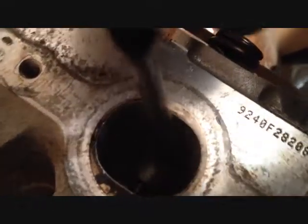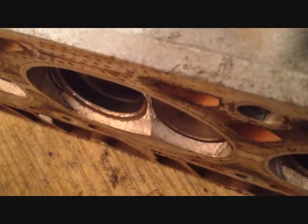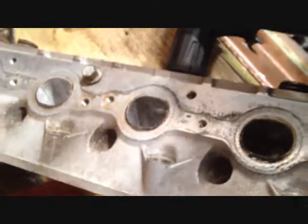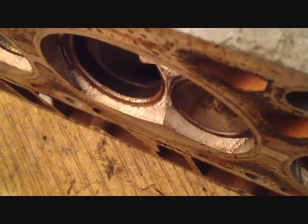Still fluid, and no leaks. So, going on to my drill valve grinding this. You can see what I was doing there. I was going till I started to bog the drill down, then letting up and then hitting it again. That way you move the valve grinding compound a little bit around the valve head, so it helps seat it. Or at least I think it does. Maybe I'm an idiot. I don't know. That's what I do.